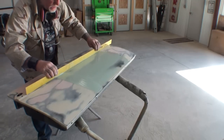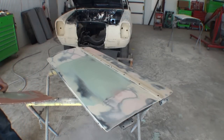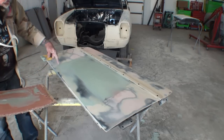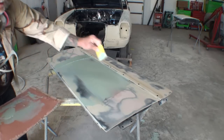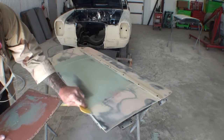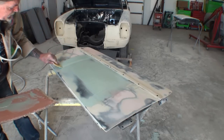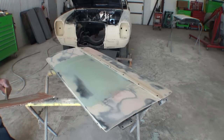Now we're going to do it again. You can kind of see the area we're working with here. Because I can still see it's a little bit over here, I'm going to take my spreader and just feather that out, then come over here and feather this out too. I want to get a little Bondo on it because it's already drying. So our dent or imperfection was a little bigger than we thought, and you can see how using the four-foot straight edge on this situation really opened our eyes.